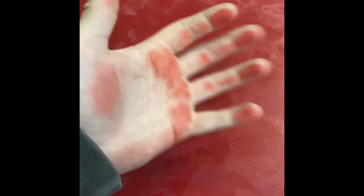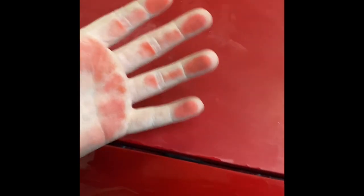Once you get the clear coat off you can kind of see all these shiny dimples underneath it. You can see it in the clear coat before it comes off — not sure if it's from little chips all over the car or just where the vapors are pulling up. This should be waterborne paint, which isn't quite as stable as others, and when you're down to just the base coat it's nothing but pigment really, so it can wipe off on your hand — watch that.